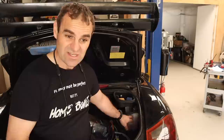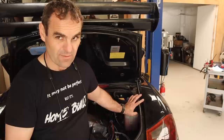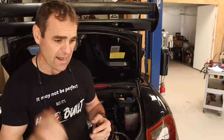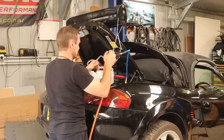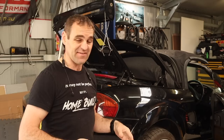Another thing I've noticed is this car has been sitting for a couple of weeks on a bit of an angle, and the coolant level has actually dropped down quite a bit, which tells me there was a little bit that spilled out last time the car overheated. I've got a feeling some of those air locks may have actually moved. So I'm going to jack it up, get the vacuum line on again, vacuum fill again, and then try to pump it through and really get some coolant in this thing. It took probably another couple of liters of fluid. I'm going to leave the cap off now and start trying to start the car, rev it a little bit, and just see if we can get some coolant flow.